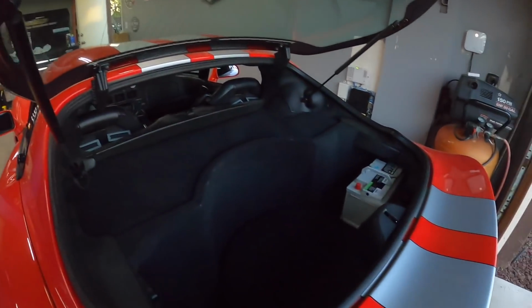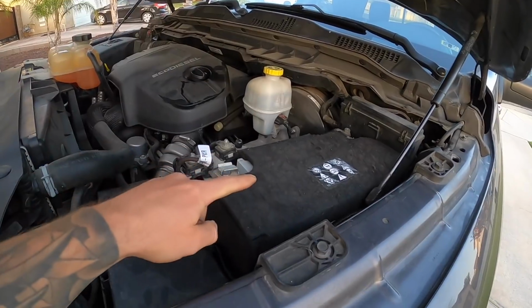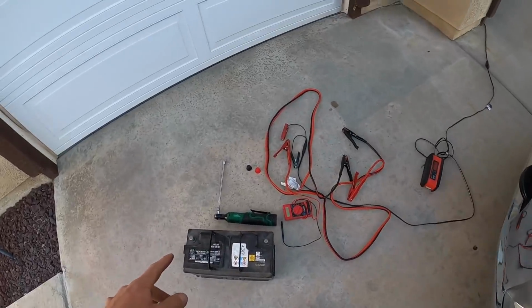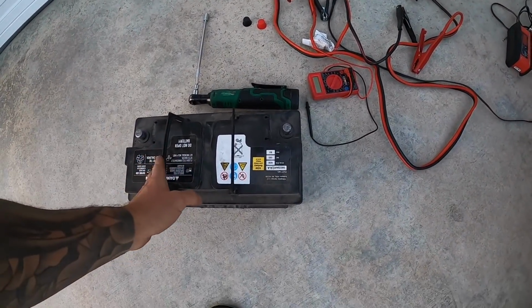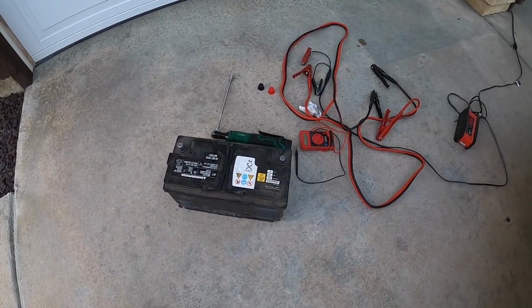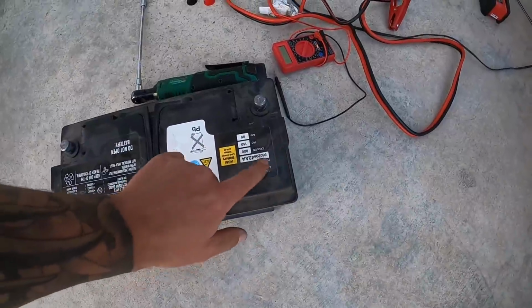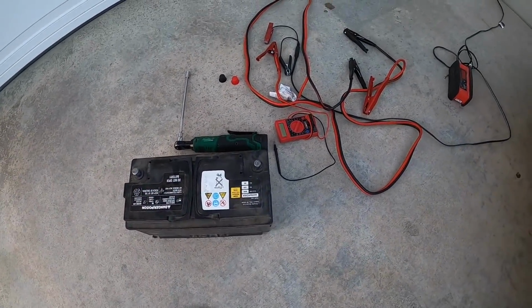And just like that, we're back. So let's get the battery out of the truck and get it into that truck. New battery is in, and just side note, you guys, usually in SoCal, batteries don't last that long because of the heat. They usually last about 4 or 5 years. So since it says Chrysler on it, probably the original battery from 2016, so it's about due anyways.